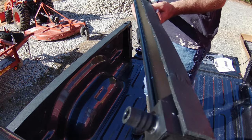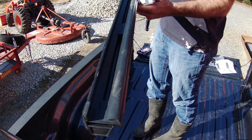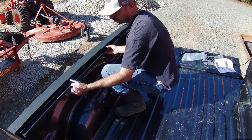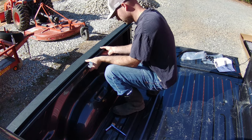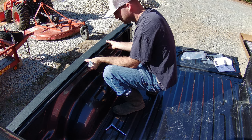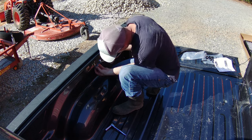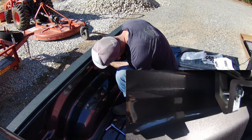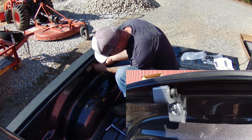There are two different ends to your bed rails — the end with the little drain piece should be facing towards the cab of the truck. The way I did it was to start with the center clamp to make it easy. If you had a helper you could position all the ends, but if you're doing it solo like I was, start in the middle — it's easier to balance and get it lined up.